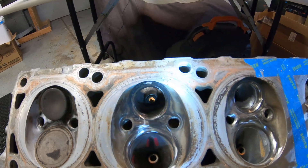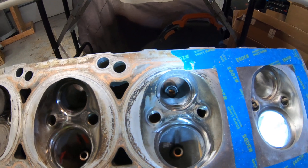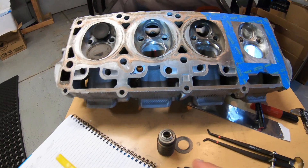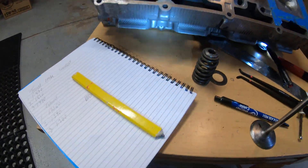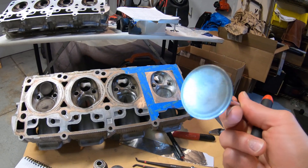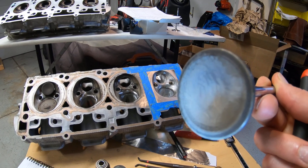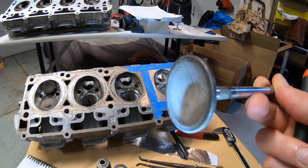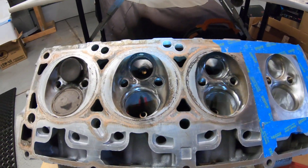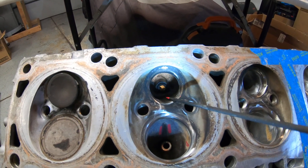So what I did was I took my caliper here, took rough estimates — this is all formulated and calculated — the percentage needed. To be direct: if you have a 155 exhaust valve, you want to target 85 to 90 percent on a race, high-RPM application to maximize your exhaust volume. And then we can use some tricks here to maintain or increase velocity.